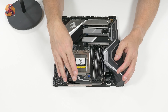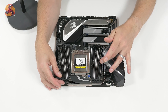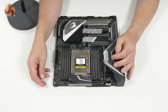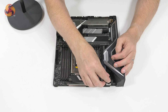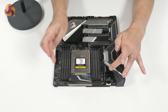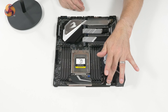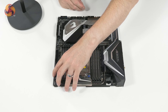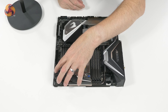Touring around the board, we have the CPU VRM heat sink. Either side of the CPU socket are the 8 DDR4 DIMMs — you can bet those are going to be RGB because this board has a whole RGB thing going on. We have 8-pin connectors at the top of the board. It'll be interesting to see how that performs. Going down the side, there's a CPU fan header, CPU optional, and RGBW — which is very much a Gigabyte thing — not just RGB but RGBW. And there's what looks like a digital RGB header.